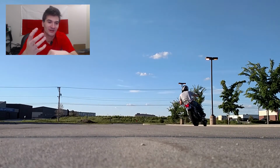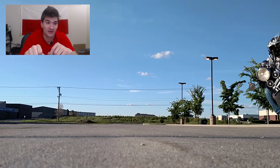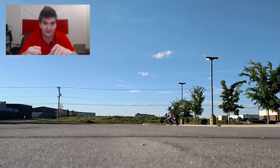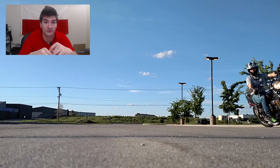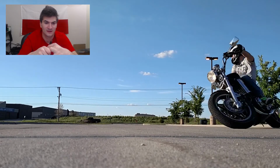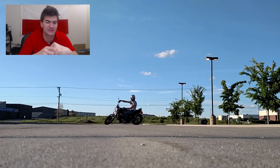to the point where you squeeze the front brake and you're all the way in, and you can feel that the pump is all the way in, like the lever doesn't go any deeper, and the bike is still not braking, right? I mean, of course you can say, hey, bleed your brakes. Okay, you can do it, but a lot of times there is the old banjo bolts or the old washers. Don't rely on it. Just get a new cable.